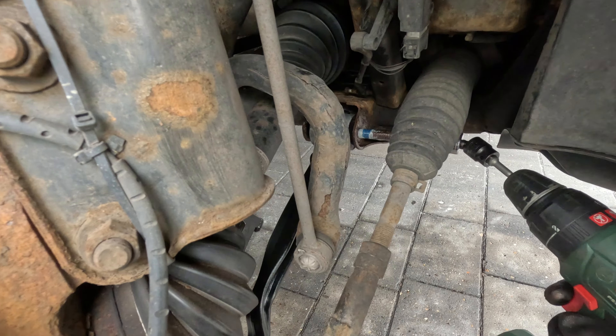I'm going to measure what we set at the beginning of the video, which is 48 and a half millimeters. Perfect — that's centered. Now we tighten the bolts. I'll tighten the rear bolt first, then torque it. This bolt gets tightened to 165 plus 90 degrees, so I'll do 160, then move five more to reach 165, then torque it.